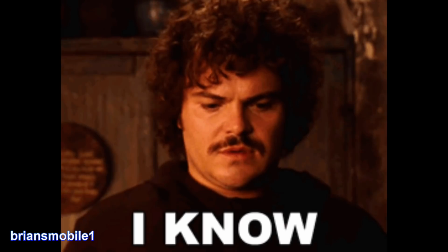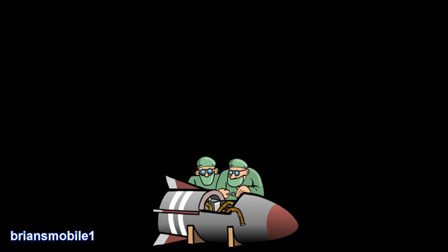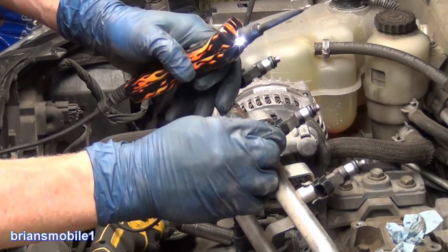I knew that some of you are going to be expecting that. I'm using circuit protection on this power probe. I've got a link in the description where you can find one. It's one of the safer ways to do things. Your PCM is at risk. You know, your 5 volt reference stuff, you don't want to run 12 volts to that. But by and large, this is a safer way to do it. And that being said, this is definitely something you do at your own risk with good judgment, or don't do it at all. See how I get that nice mist of fuel?